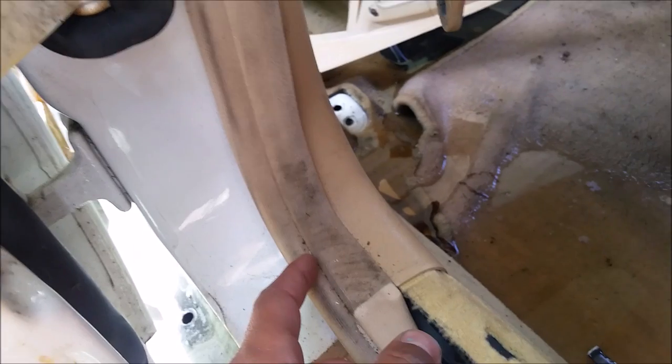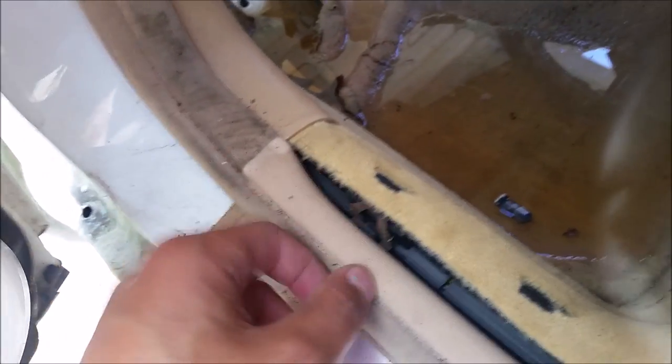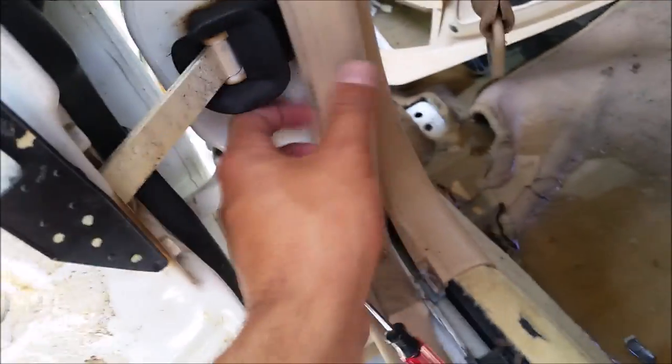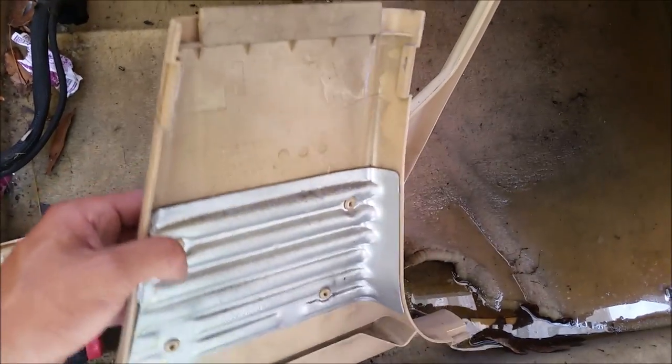You've got four clips on this plastic piece — two on each side. Once you're done with the first side, removing this weather stripping and the panel, you come to the other side and remove the weather stripping as well, so you can get to the clips underneath. Just take a little flathead screwdriver and pop them right out.